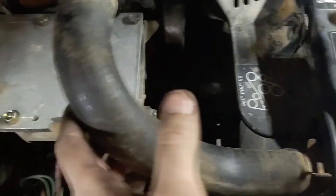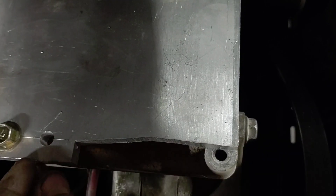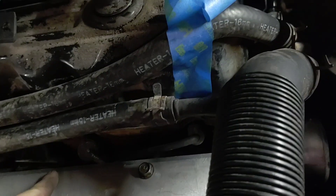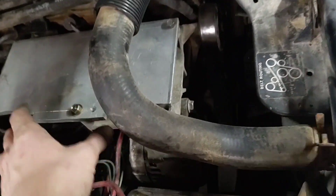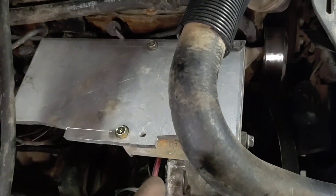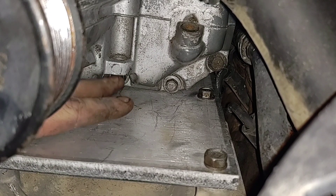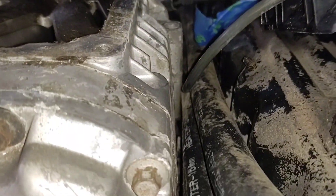We'll get these drilled — plate drilled. The plate's on there. I missed a little bit, but that's alright. Now you can see this tail — it's just enough, just enough not to make it. It's tight on these, but the bolt's going to go about right here so I'll be able to notch this out where that wire is, so it shouldn't be a problem. The other bolt's going to be about here, so I'm going to have to clean this up and take the other piece I cut off and weld it over here. I'll set the blower up there and look at it — maybe get the front hole and get some bolts in. It's probably going to be about that tall. See if I can get it kind of half bolted on there. That's how far the standoff is from the plate, so I'll have to stack something up just a little higher than that to start with, and then I can get it leveled in the back.